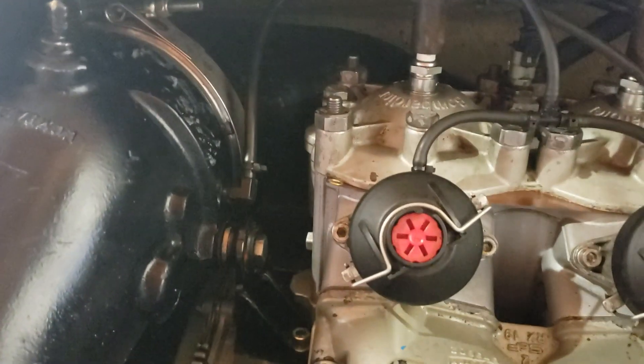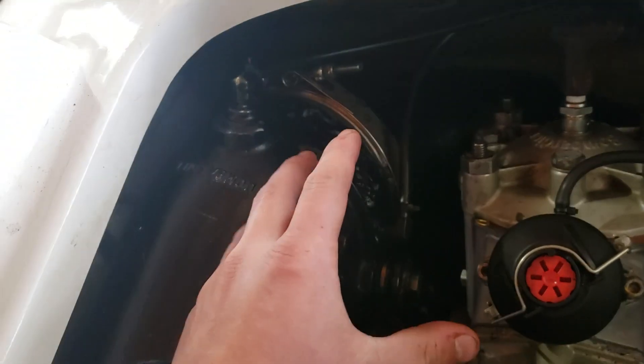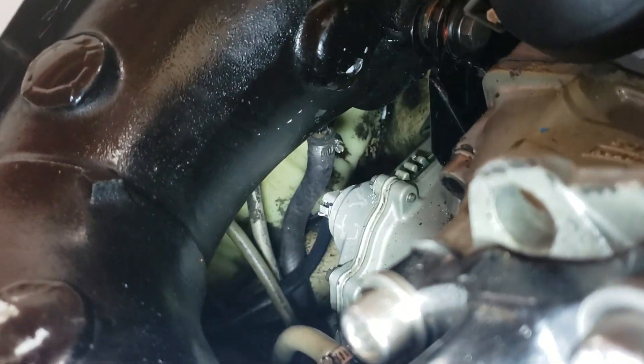After the carbs come off, it's time to start removing the pipe. The pipe is bracketed on the motor in two locations — one right here by a 17mm bolt, and then there's one on the back side. If you just look at this cooling port and trace right down, you'll be able to feel the whole bracket. That's an Allen bolt — get it out and that's pretty much all you need to do. Next, you have some small, tiny vacuum lines. One right here, and these two right here. The bottom line is the one that runs to the rave port. After that, you have a cooling hose right in there. Mine's hose clamped on — I'm not sure how it comes from the factory — but you're going to want to get that off.